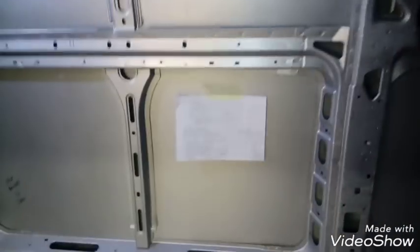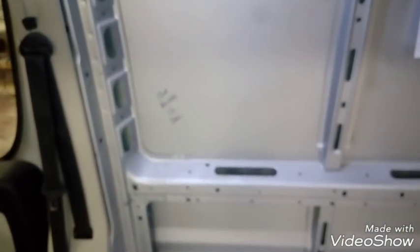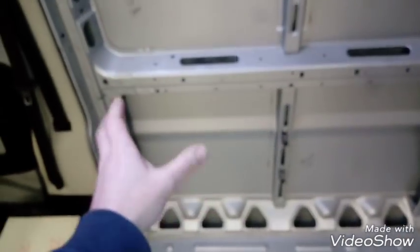Still need a little bit of cleaning, but one of the first things I start off with — I check the list I've got and the layout I'm doing, and then I write on the panels roughly where my partitions are going to go. That gives me an idea of where I need to run the wiring.